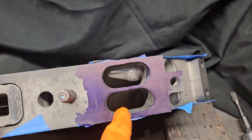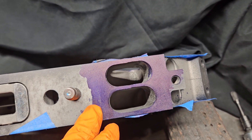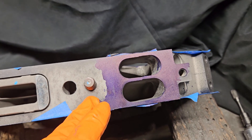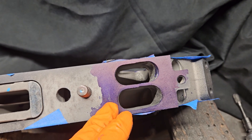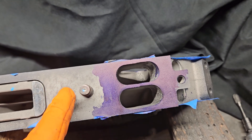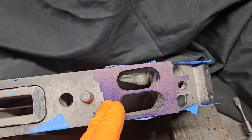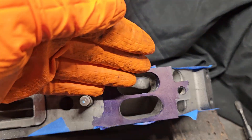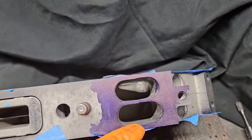When we were checking our touring cars and trying to get all the performance we could out of the Renesis engine, this type of modification did make a difference. We'd port match the intake manifold to the motor, making sure we were getting nice matched volume flow with no sharp edges or offsets.